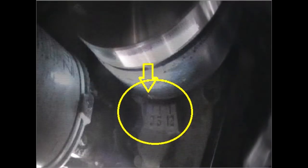I don't know how well this camera is showing up, but if you can see that there — my timing is exactly wrong. It is just after zero; it should be on 5. So I'm going to adjust that distributor to bring it to 5.